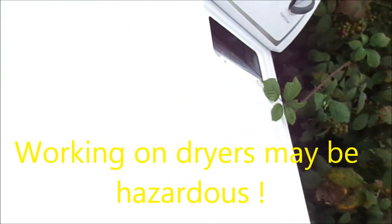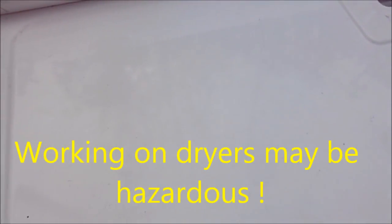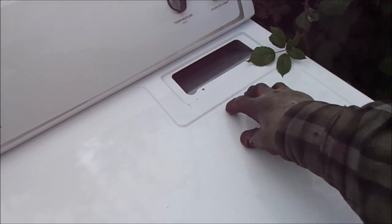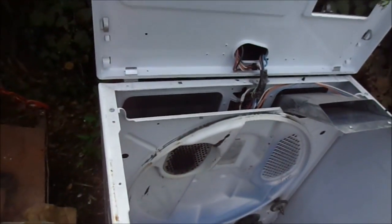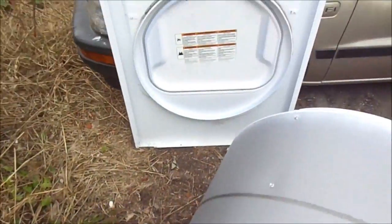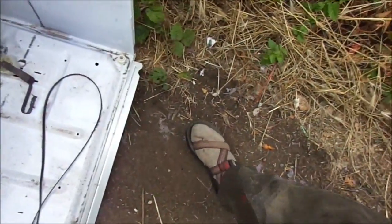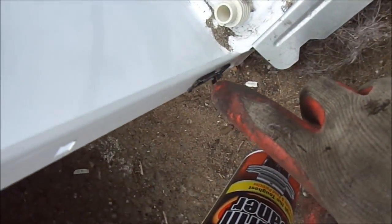The complaint with this one was that it squeaked. Let's take a look at it. We're gonna take it apart here — remove these two screws and pop the top panel off. Then remove the screws that hold the front panel off here and here, and the front panel will slide up and out. You can see the little hooks right here.